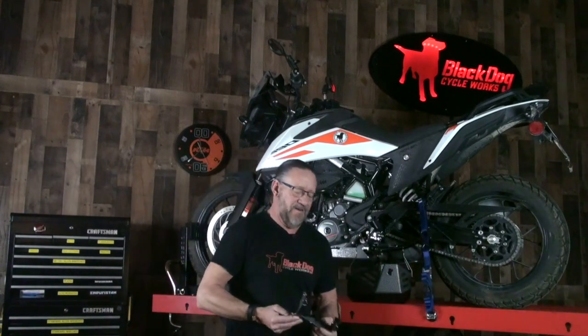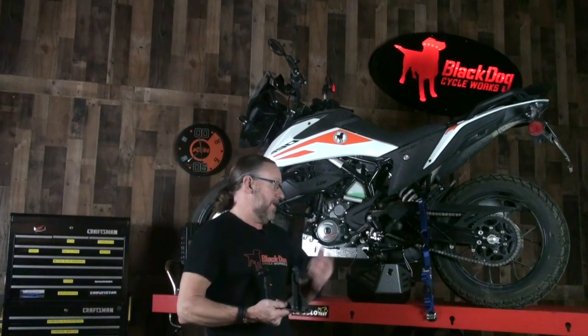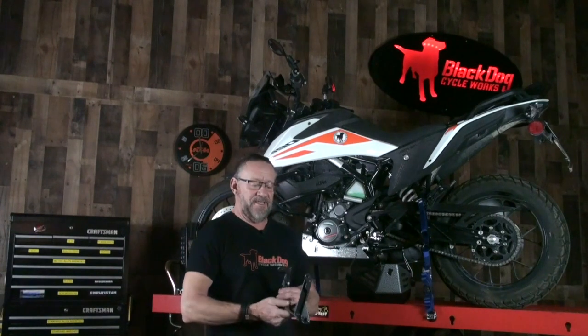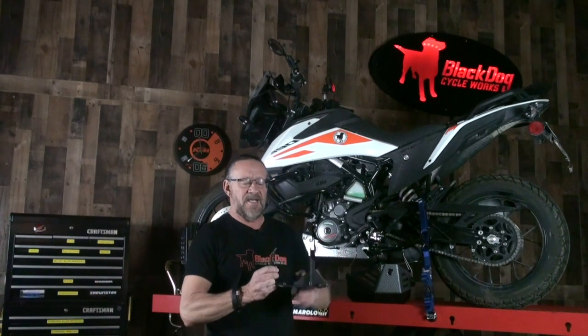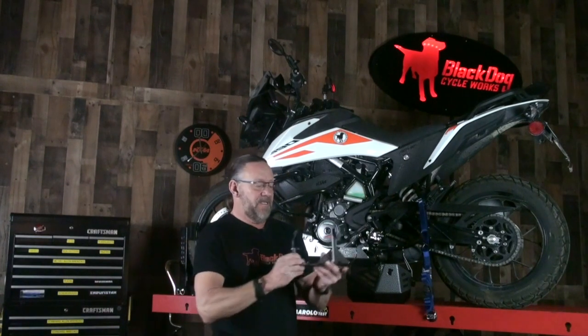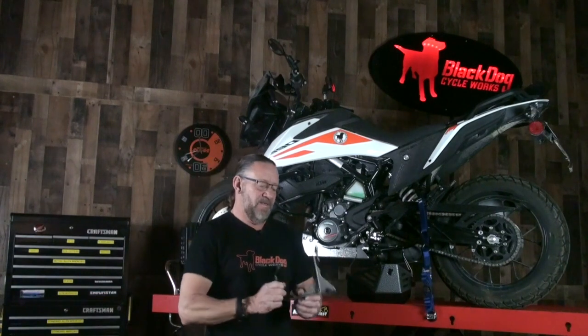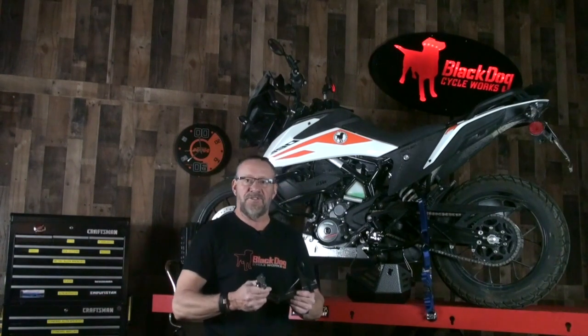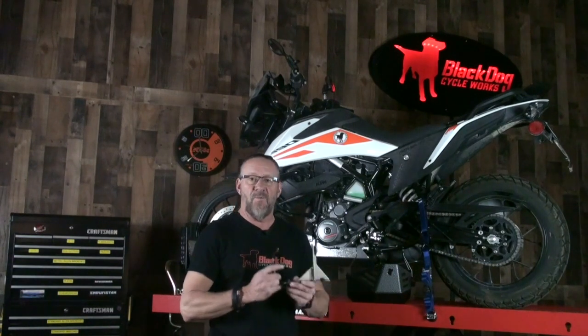I came up with a very innovative rear mounting bracket that creates a ton of strength and gets the skid plate off the engine case. This actually ties into the frame of the bike on two points on this side and two points on this side, and then it hangs down below to attach the skid plate to the bottom of it. This is made of steel — a very, very strong unit — and again, it gets the mounting system off the engine case and to the frame where the most strength is.